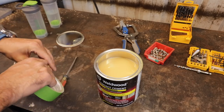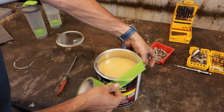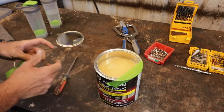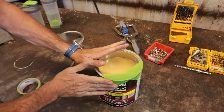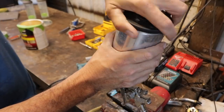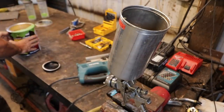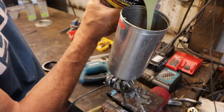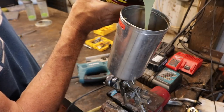This is a cool trick I learned from a guy I was watching on YouTube who carpets speaker boxes. He said when spraying adhesive, take some masking tape and do a little V pattern on your can when pouring into a smaller receptacle. It really works good and helps keep the glue out of the seal. As far as spray guns go, this is not a fancy one — just a higher-end Chinese one. You don't need anything fancy; you can get something at Harbor Freight inexpensive. There's probably a better adhesive designed for spraying that's a little bit thinner, but it seems to work good.